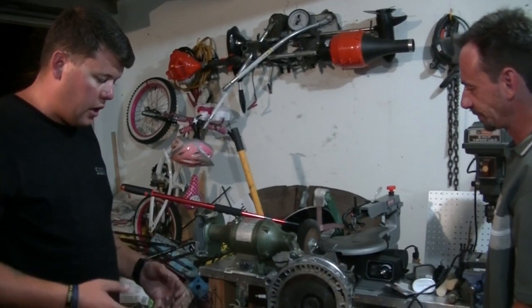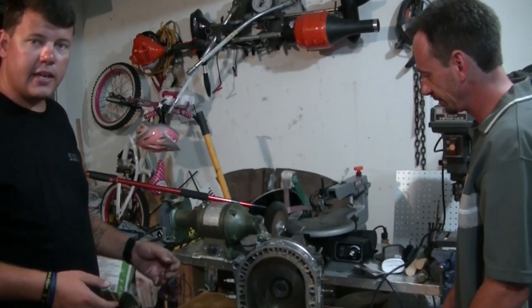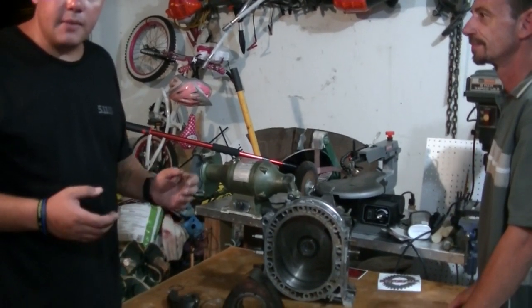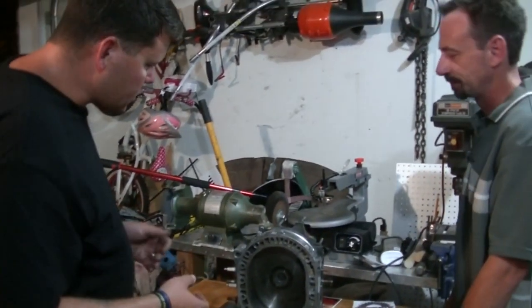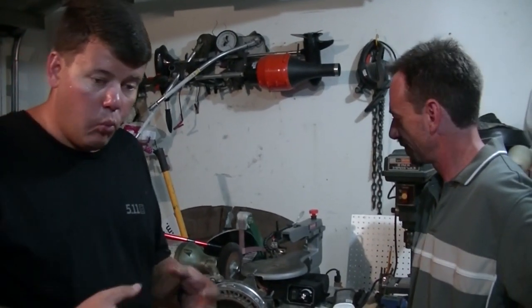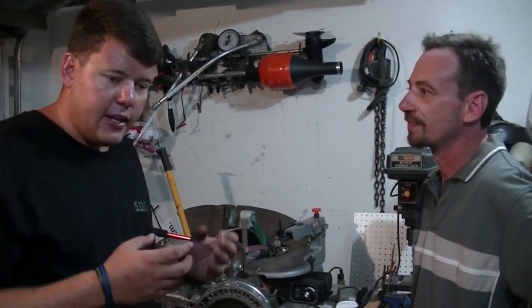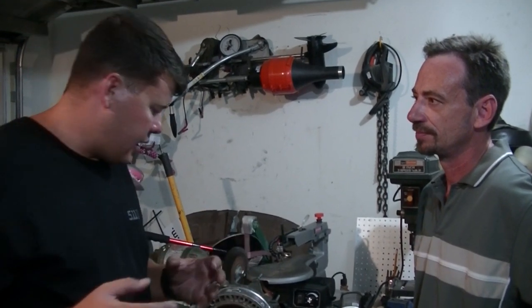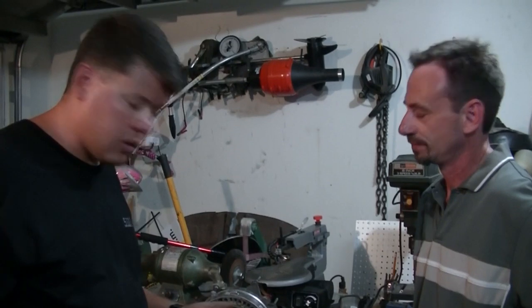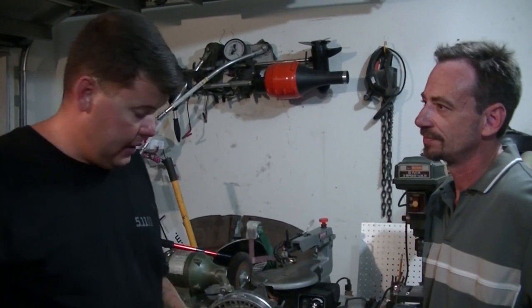In the rotary world, all of us always have something to say: that a red line a day keeps the mechanic away. So what that means is, once the engine is pre-warmed, taking it to red line is lubricating everything, clearing out the combustion chambers, clearing out carbon, making sure everything's in motion, there's no hang-ups, stick-ups, and so forth. If you do that every day, it's great.